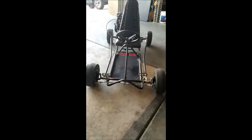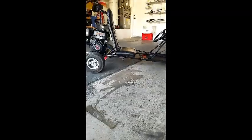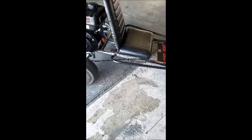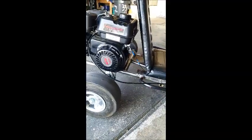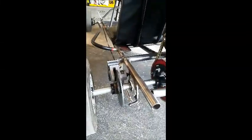When you look at the frame pieces, they came out pretty good. The stance looks pretty good — it's a little high in the back and you can tell when you're riding on it. What I did is cut just behind the seat and moved the seat back, because the seat used to be right about there and I had no leg room at all — and I'm 5'8". I didn't really make it longer; what I did is cut the rear end off and fabricated a new rear end. That way it was a live axle instead of single drive. I put the axle on, put the brake on, and mounted the pieces underneath the frame. All in all, I think it came out pretty good.